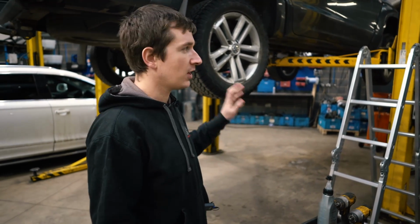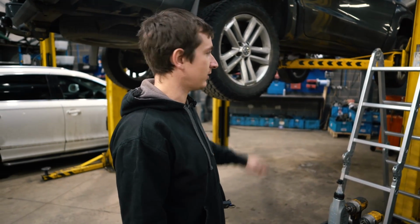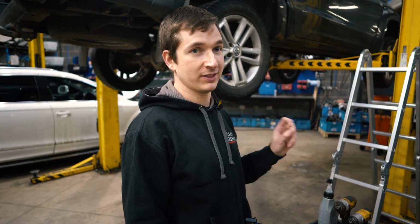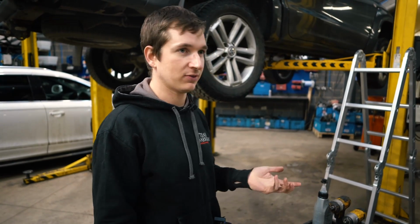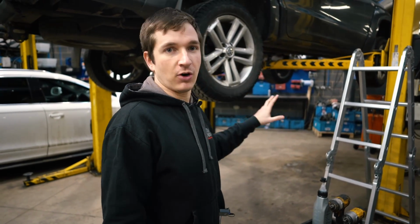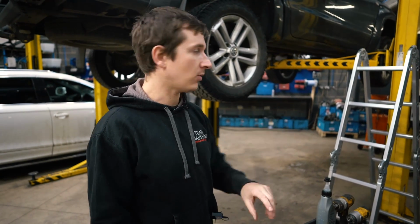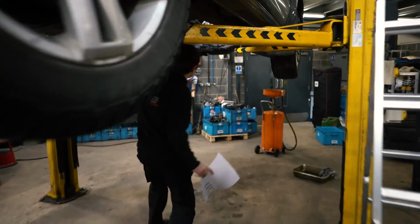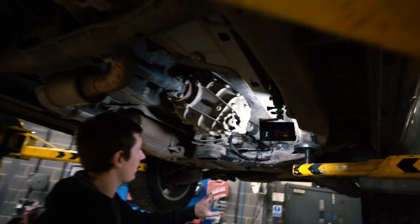The BMW stuff, because we've not done that many on Volkswagen stuff, but the BMWs that we do it on, the thermostat opens pretty quickly and you can see when it's opened as well. It must have an electronic either sensor or switch on it or something, but anyway. But this never got warm. You could feel on the pipes that it never got warm. So he's thrown all the... Paul did it without me asking him to, because he's good like that.